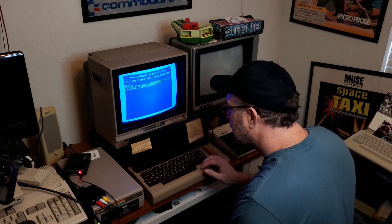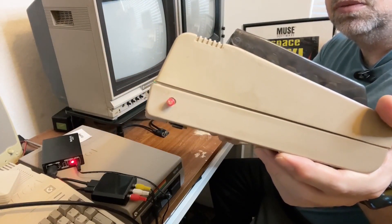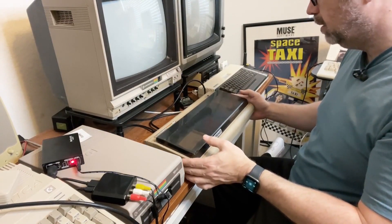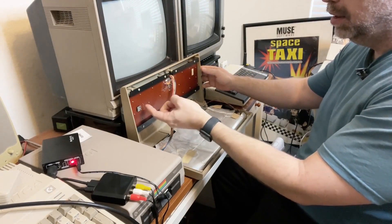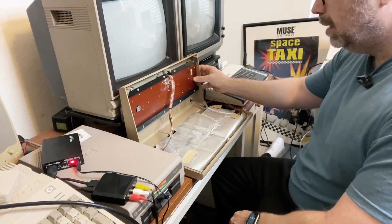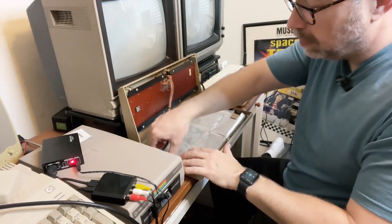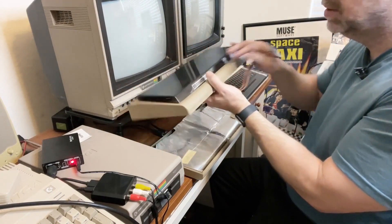Let's open this up to see what's inside and how dirty it is. There's a little tweak on it — see the red button? That's just a reset button they built into the keyboard, which is actually a really good idea. I always hate switching it off and on. Looking inside, I can see the shift lock key isn't soldered on and it's disconnected. I definitely need to get in there and look — I'm sure this has been worked on a lot since it has had tweaks done to it.